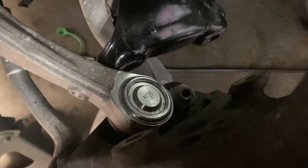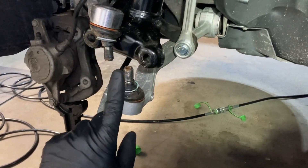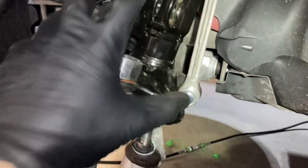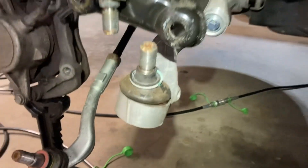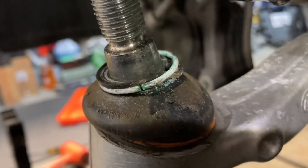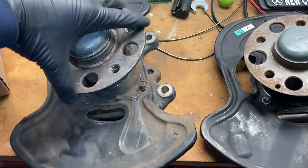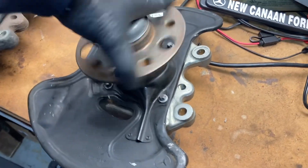Upper control arm ball joint is separated. Going around to get the lower control arm ball joint separated — actually not so bad. Here's the wheel well with no knuckle: one ball joint comes up (lower), the front one comes in and points down, the strut pulls there, and the tie rod pushes and pulls. With the ball joint separator these spring clips tend to come undone, so check all ball joints and make sure none are left open — that'll really decrease their life. Here's the old knuckle with hub and dust shield still attached.